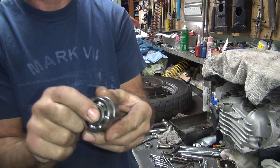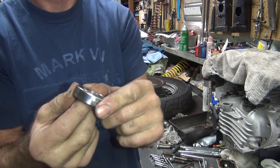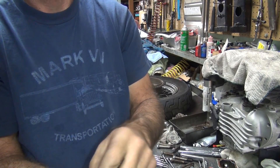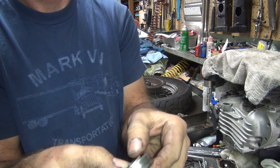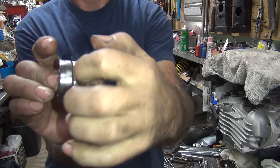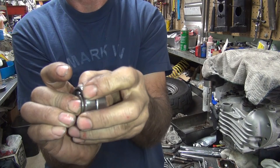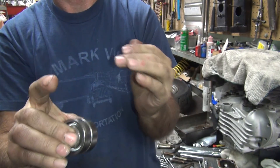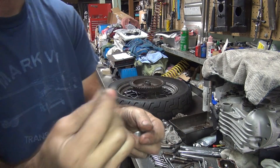When you put the two bearings together and stack them up, you have to have a spacer between the center part, or it only hits on the outside edge and locks the bearings up. That's what they make this little cup washer for. It goes over the bearing, then you put the two together — there's a little bit of space between them so it doesn't load the bearings. That way you don't put pressure on the side of the ball. The ball sits inside a cup race area; if you push it on one side or the other it will kill the roller. Make sure you put these washers in there and don't lose them.